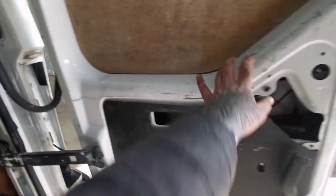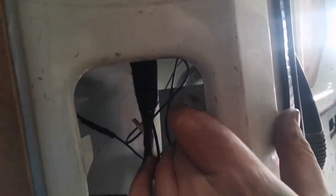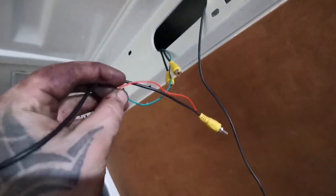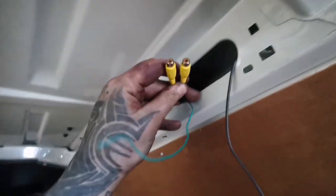How to remove the reverse light is pretty simple: one bolt in there, open there, and one in there - that's it. Now all I've got to do is tidy up the wiring. I'm going to tape this up - the red cable needs to be attached to this green one because the green wire is the rear trigger. Plug it into one of these, tape it all up, put the ground on, and finish the wiring.